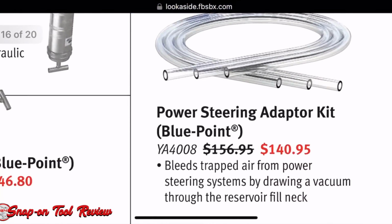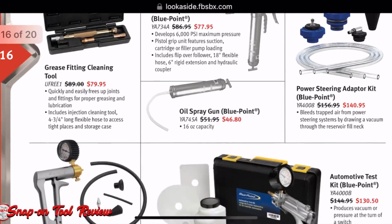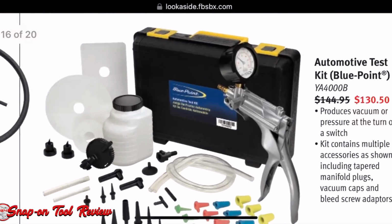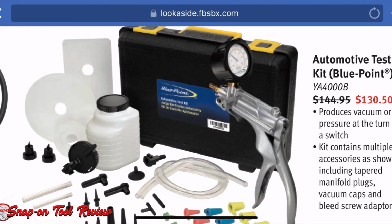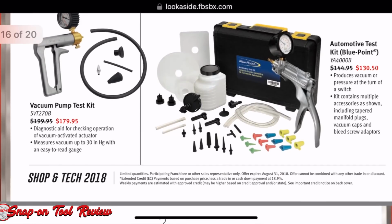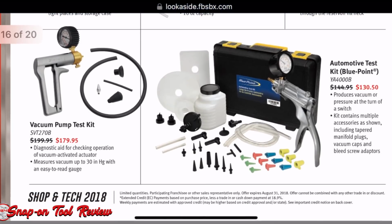So, bleeds trapped air from power steering system. So if you're working on a lot of Chryslers, Fords, something that is relatively hard to get air out of, that's the job for you. That is the tool for you. You can also do the same thing with these guys, and you can save the $140 and just buy a vacuum gun and do it that way. Really good for getting air out of power steering systems.